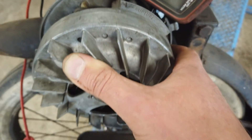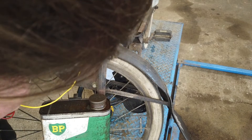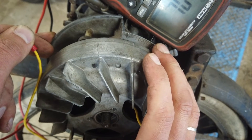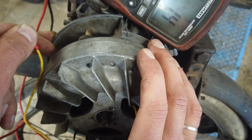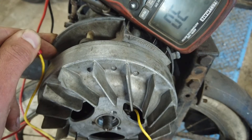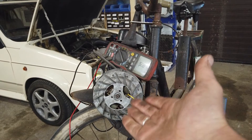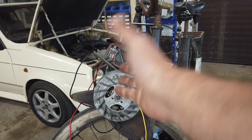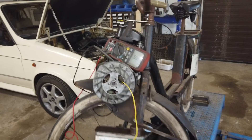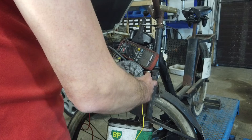Let's try that. Let's loosen up the points - then we want to close it a little bit. You will notice that the beeping stops at one point from one direction and starts at another point in the other direction. So you will have to move it a bit about to just find that sweet spot. Which I'd say it's there now - bang on that point. By doing it like this, you will know the spark arrives at exactly the point that the engine is supposed to be firing at, if it's completely standard of course.